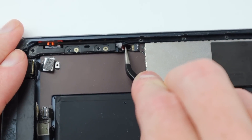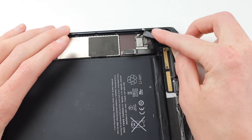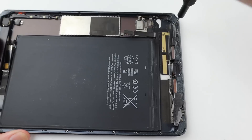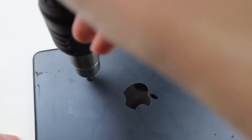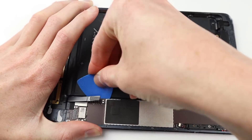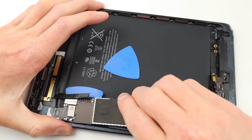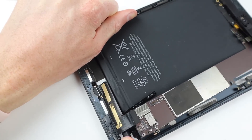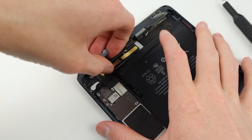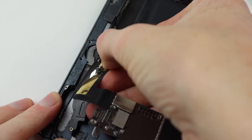To avoid this I'll need to change the frame with one that doesn't have dented corners, and for that I'm going to use a donor iPad mini which has a dead logic board that has no power when connected to the charger. I'll need to disassemble the iPad and remove everything to transfer across — for the most part just the logic board, as all other components are already installed in the new housing. I'll need to flip over the iPad and heat up the back because of more adhesive — the logic board is actually held down by adhesive unlike screws found in an iPhone. This makes the repair more difficult and you run the risk of snapping the logic board. The dock connector also needs to be removed at the same time as it is soldered to the board.